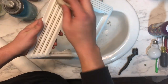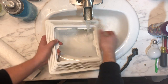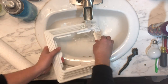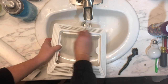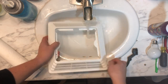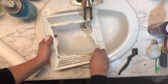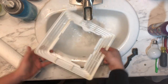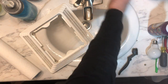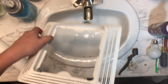You can go ahead and grab this cover — this can be put in water — so using the same thing, you just kind of go back and forth and get that all nice and clean. The goal of this is so it doesn't build up as quick and that the ventilation can actually work properly, because the ventilation only works on the sides here — it doesn't go through the light, which is pretty obvious — so there's not a whole lot of space for it to go through if these are all clogged up. Do this every year or so and your fan should last a lot longer — just a little bit of preventative maintenance that goes a long way. Let that air dry for a minute or two; you can also start cleaning up your area.